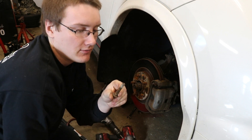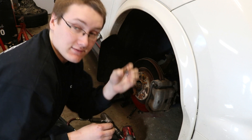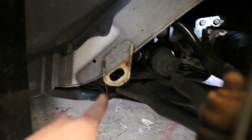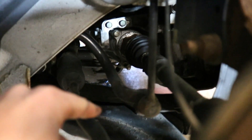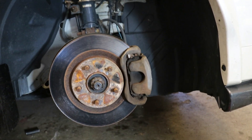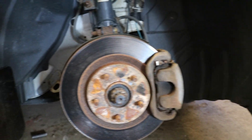And there's my bolt — fortunately it doesn't look damaged, so I might be able to reuse it. Now this next bit is going to be kind of hard to show you, but you actually have to slide the control arm out. Get a pry bar behind the rear mount and pop it forward, then stick a pry bar back in and pop that side out. It will hang by the ball joint and that's fine. You're going to want to turn the steering wheel in one direction so that it's facing towards you so you can get to the side of the ball joint.